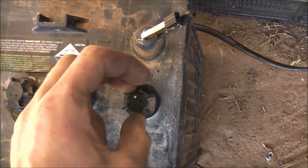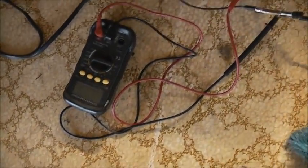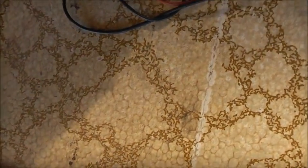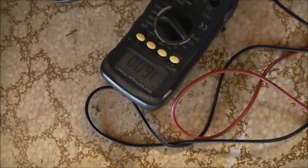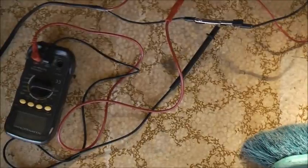Yeah, slowly, slowly. That ballast might be restricting a bit too much current, but I want it to do it evenly — not cook the battery too much, even though they recommend cooking it, which helps speed up the desulfating process. And it's going down to 16 volts now. It's taking charge. The fan's helping quite well — it's working pretty adequately to cool down.